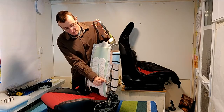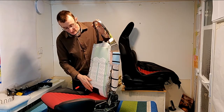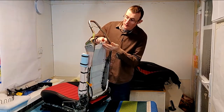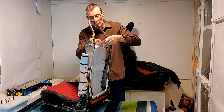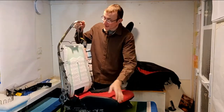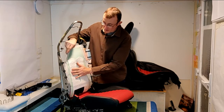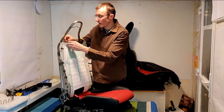These are the things that we were uncoupling the J-clips out of, and that reveals the seat frame support and the heated seat back, and of course the airbag assembly. Should you wish to, this seat back literally unclips. There's 2 clips at the top here. 1, 2, and then on the back edge the seat frame unclips like this, and you can unclip it all the way around to reveal the seat back. I'm not going to, because I don't want to risk damage to the heated seat mat, but that's something that you can do if you're interested.